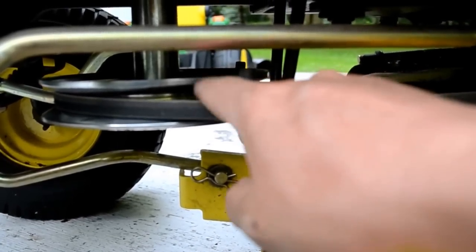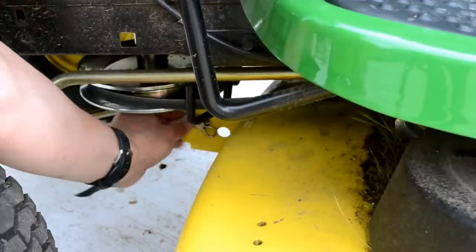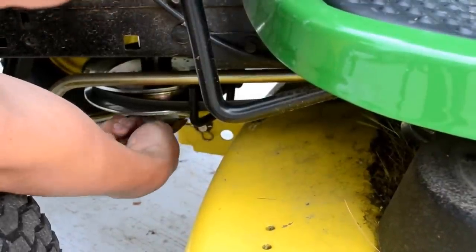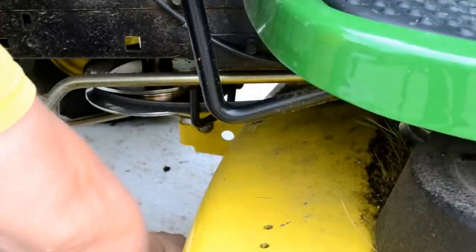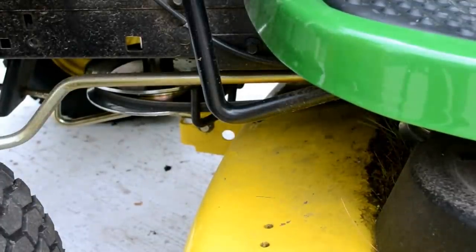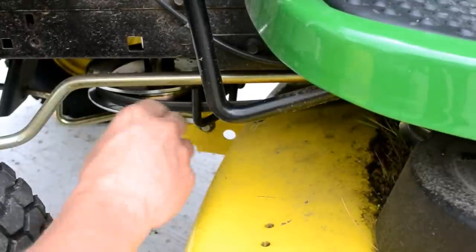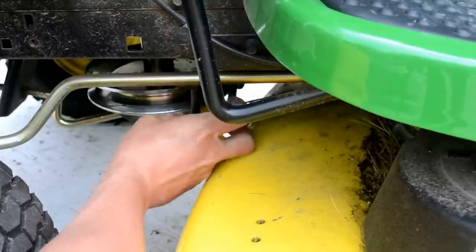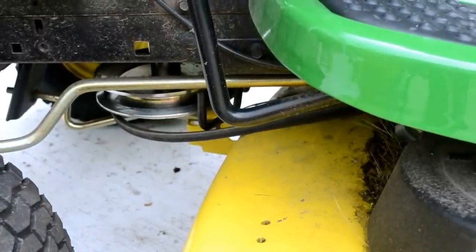Towards the front, we have a cotter pin on the front deck that's going to come out. I'm going to try to set it up on the tripod and pull that out. Additionally, we'll pull the belt off the front, then do the same thing on the right side, and that will drop the deck. I might have to get pliers to reach in there. Okay, that one came out with no damage. Now we'll loosen up and take off that belt, feed it around the pulley.